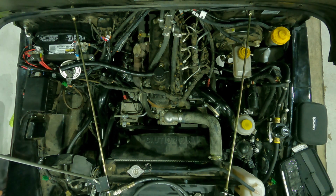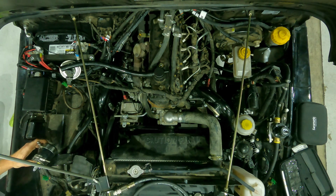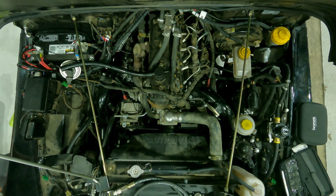That's something that I think a lot of guys tend to miss is you see, hey, I got peak boost or I'm not getting enough boost, right? So you immediately go right into it and say, okay, well, what does it hold at 10? Yeah. And that's about, I think, especially on one of these, what most guys are going to see under normal conditions. Yeah, 100%. Right? And then once you start putting more load on it, you hook a trailer to it, or you really give it the beans, that's when we're going to start to expose some of those problems. Oh yeah, 100%. Because that's when your boost levels are really going to be at their max.